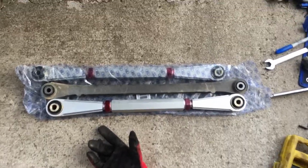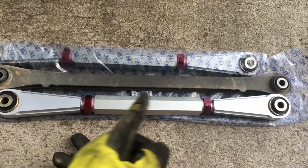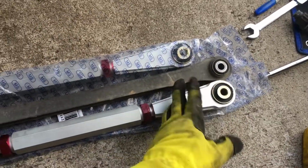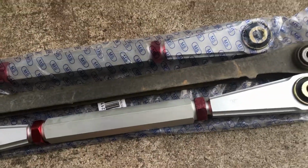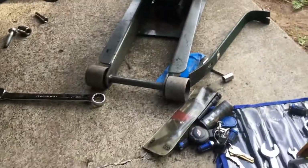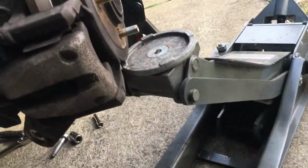The old control arm is out. I'm gonna set it somewhat close to the previous settings, but a little bit shorter because I had too much negative camber. So I'm gonna do that, and then let me just show you the setup. I have a floor jack holding the hub right there. This used to be right here, and back there